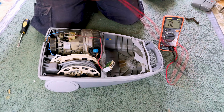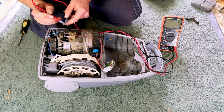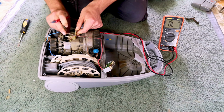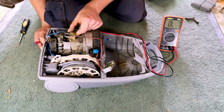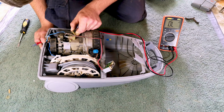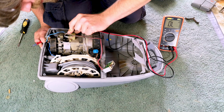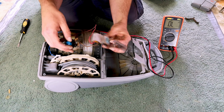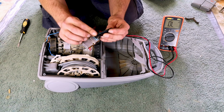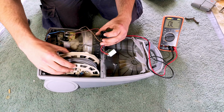Usually the RF suppressor is like melted. This one, there's still no continuity. And I've known them break even when they seemed fine. And I'm sure Mr. James would want me to take this off anyway. Who knows, really? I don't want to move it just yet because I don't think it's the problem. I've got a feeling that maybe something else is awry. Maybe it is something to do with this being so full of fluff that nothing is going its way.